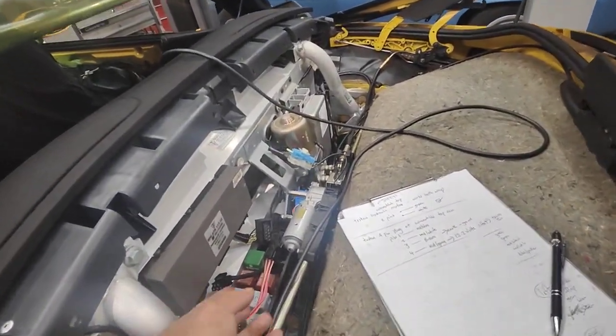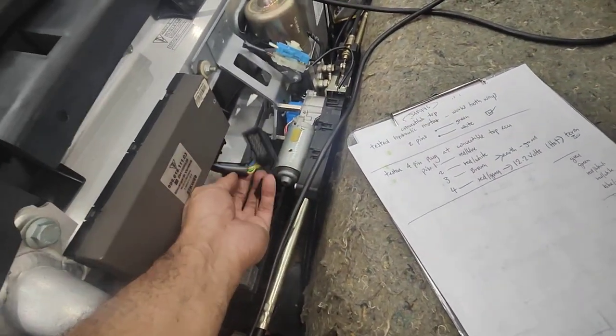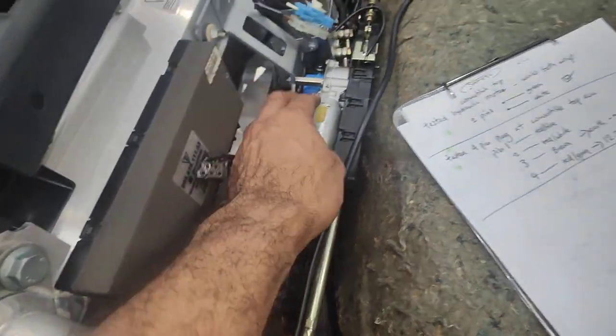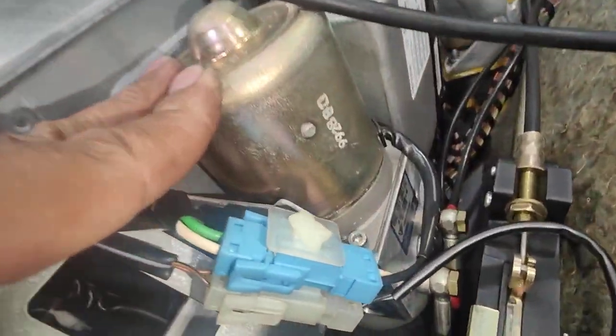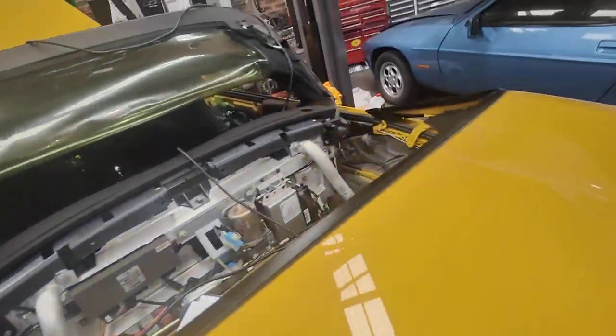As you can see from previous videos, it was very hard to put your hand in from there. Now it looks very easy — looks easy to do, especially this one here. This one here is for the deck lid motor, which controls this deck lid here. This is your hydraulic motor here to control the actual roof. This motor here pumps fluid into the cylinder here — you've got two cylinders, one on the left and one on the right.